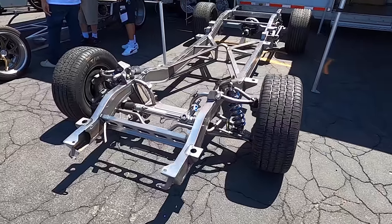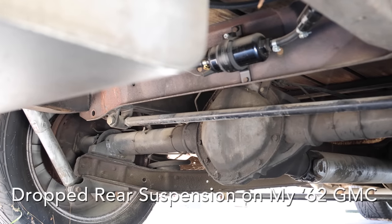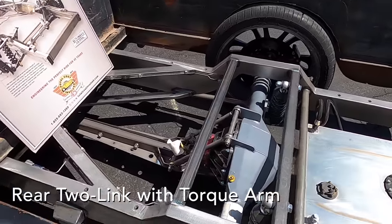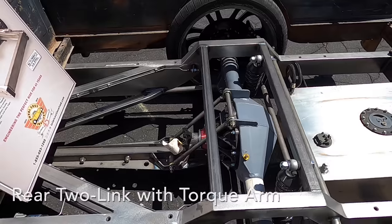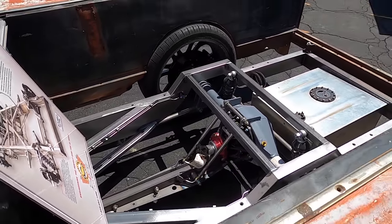Having bigger brakes on the new chassis is definitely going to be an improvement. The old suspension is a torsion bar setup which works okay, but the new chassis has an independent-style front suspension with coilovers, which really allows me to tune everything — that'll be a vast improvement. In the back, I did put in a different rear end from the original factory equipment with a trailing arm two-link setup, but that only gets so much results. The new equipment has a brand new linkage system and a torque arm, because that chassis is called a pro touring chassis and it was designed for racing. I'm not planning to race, but I really wanted the performance.